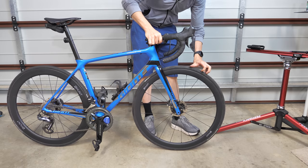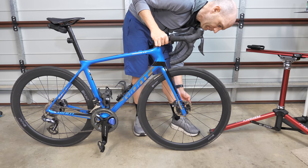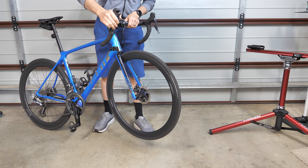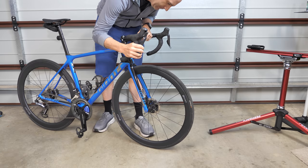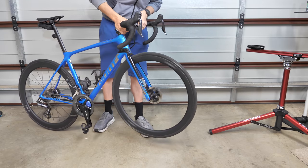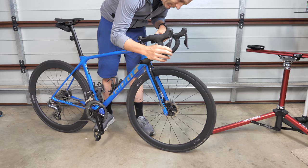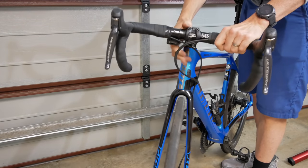And finally the true test — the reinstallation of the wheel to see how well the brakes perform. Spin — and next to nothing, because I need to pump the brakes just a few times to push those pistons out with those half-worn pads. A few squeezies and we are back in action. Brilliant, back to where we were, and all is well. A full rotation test to make sure the brake lines aren't getting caught up on anything — and they've got the freedom to fly.